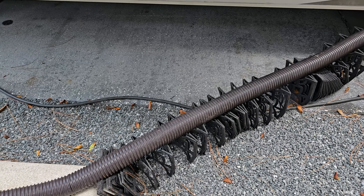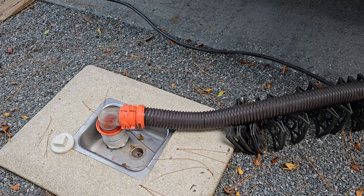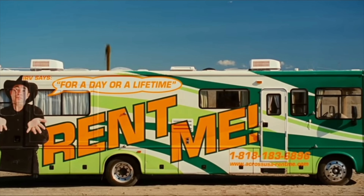When making all your connections to your RV, be absolutely positively sure that your sewer connection is secure. The very first time Sabrina and I went RVing, we rented an RV and had watched the RV Geeks, who told us how important that connection was. We thought we had it secure, but it was not. When you open up your tanks, there is an incredible amount of pressure that runs through that hose. I didn't have it connected well and caused what I would call a 'Poo-cano.' This shot straight up in the air because the valve came off, flipped upside down, and shot straight up.